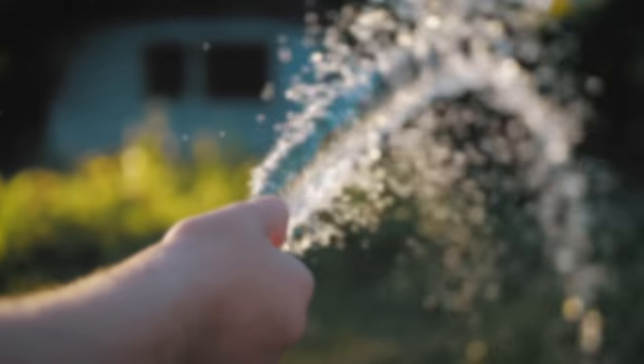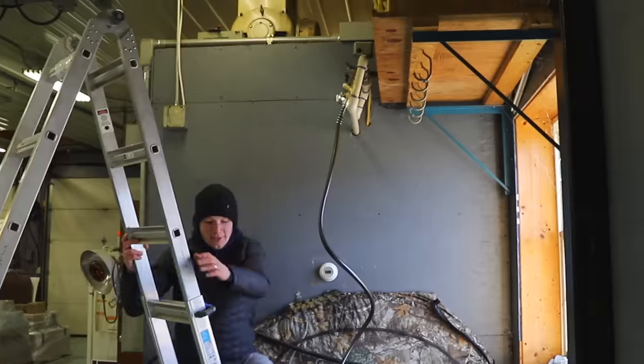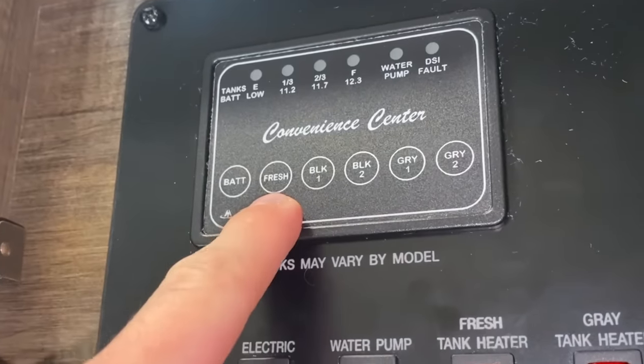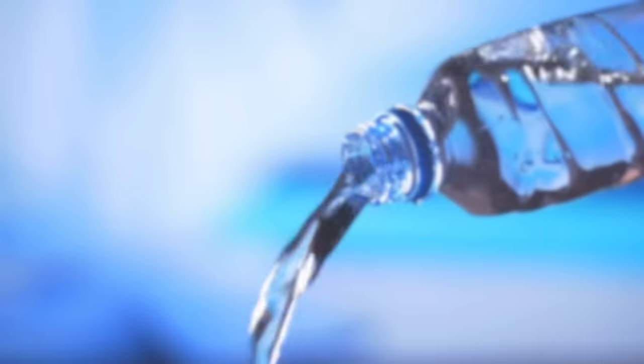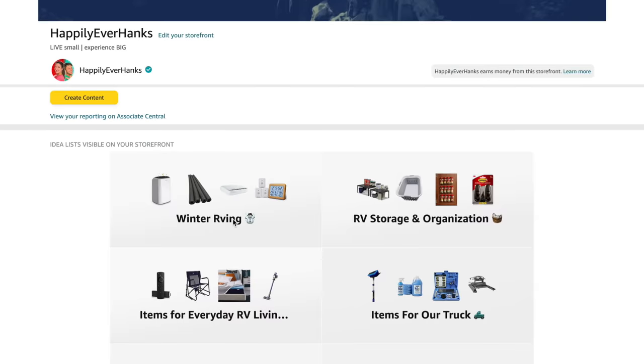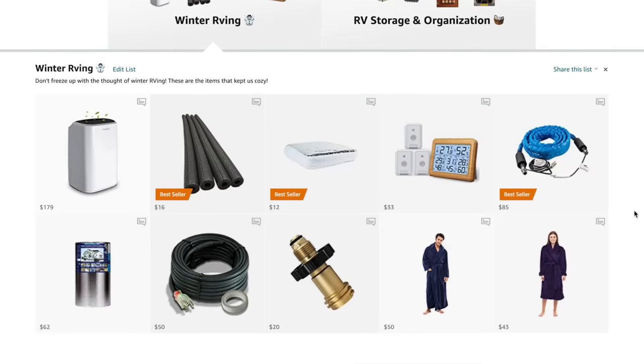Since we talked about the heated underbelly, let's talk about the water lines, because that's what will give you problems. A lot of people wonder: do I have to get a heated water hose for winter RV living? What we did was fill up our fresh water tank whenever we needed water — hook up the hose, fill the tank, undo the hose, then run off our internal water pump. Our fresh water tank is 91 gallons and that lasted us almost a week. It's all according to how much money you want to dish out and how much convenience you're looking for. Those heated water hoses can get pretty expensive, but they are considered safe for drinking water, so if you want to be able to drink fresh filtered water continuously, that might be the route for you. We've got a whole Amazon page of winter RV living products linked in the description.